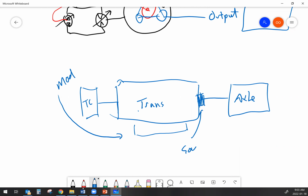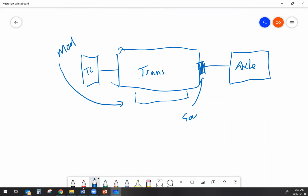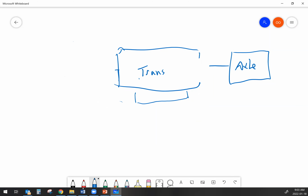Nowadays, that's not the case. If you've got a simple mechanical power shift, we're going to start with that and work our way up from there. We take away the governor. We take away any modulation. This transmission is still the same thing: a series of wet clutches, brakes, and gears. And then all you do is hook a lever up, and that lever lets you position a shift spool to select whichever gear you actually want. That's a power shift. So you are the one who's in control of which gear we're connecting to get power from the engine to the axle.